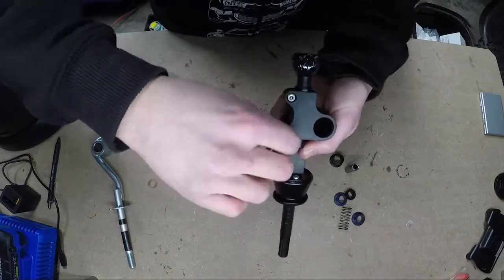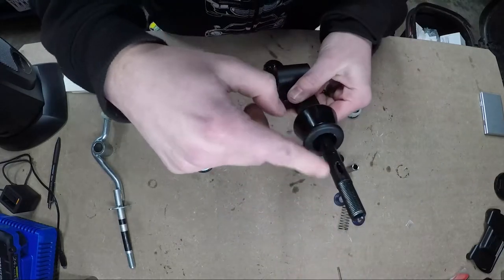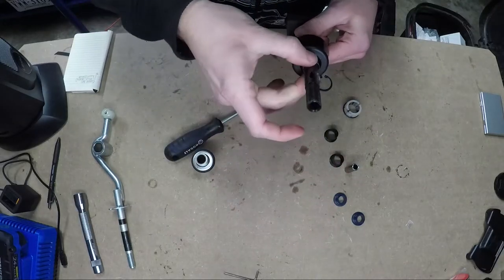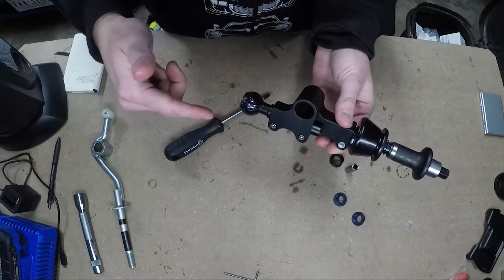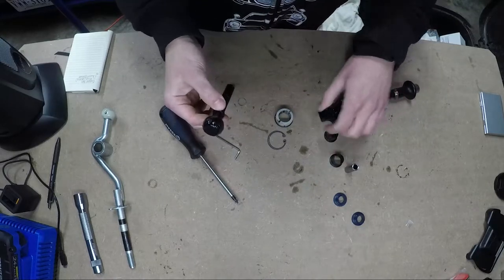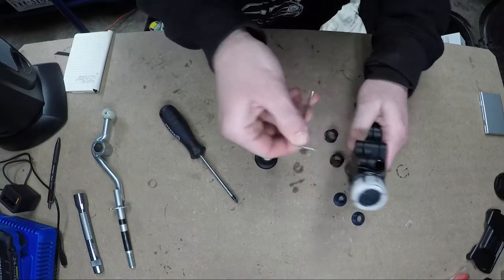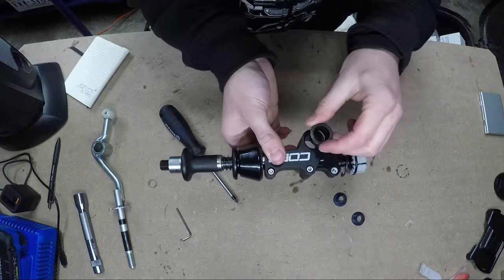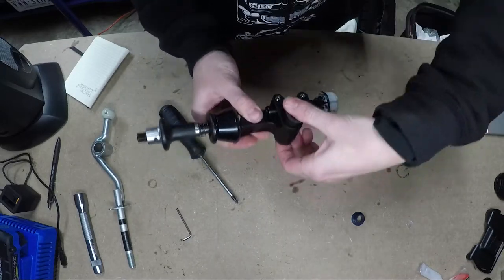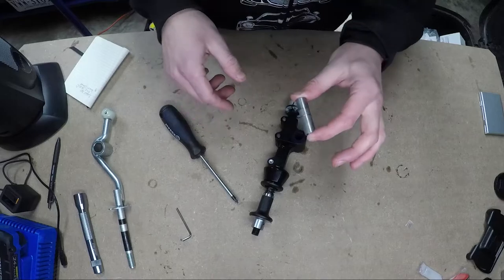First thing is installing this piece. With that piece missing, it makes it easier to just re-drive it through. Turn it up a little bit. There are two little Allen keys — you can also set height adjustment with this, make it a little bit higher if you want. Make sure you grease up this shaft. Slide the lever on and make sure the ball is lubricated. After that, you're going to need to install these adapters so you can fit the bushings back in there — same thing on the other side. Put some grease on there and slide it in.